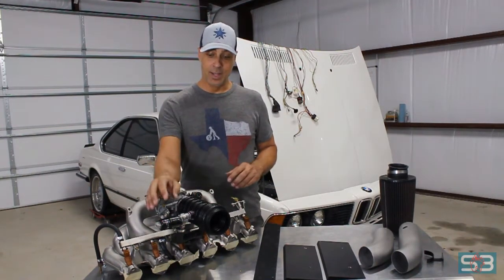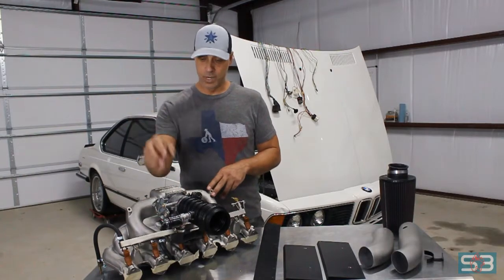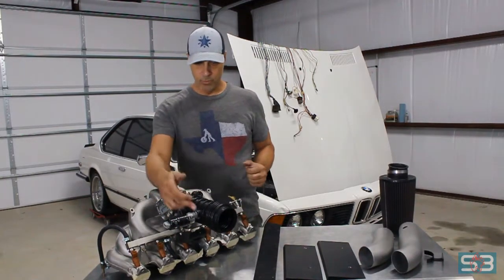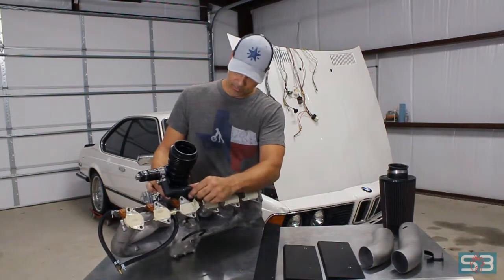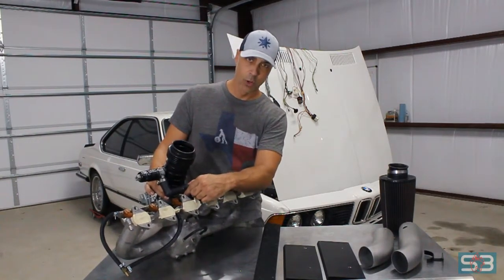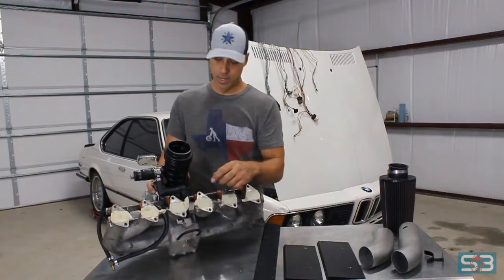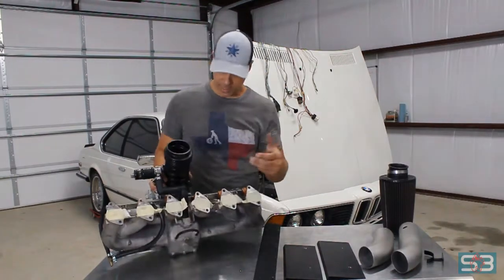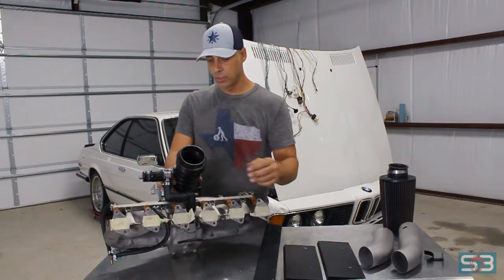So what I ended up doing was getting an E30 type idle valve — I think it was actually used in the earlier five series and six series as well. I just stole that off my race car. It fit right into this rubber plenum, into this port that was already here, so that made it really easy. I did have to make the output — this little hose thing. These are two elbows I got off Summit, about six bucks each. This is three-quarter inch heater hose that I adapted there and used a little rubber glue to basically glue everything together to make one part, and it fits great. It looks stock. It goes into the port that was down here for idle air bypass. So that went really well.